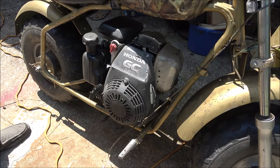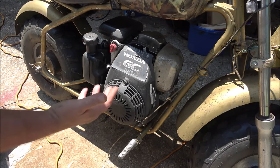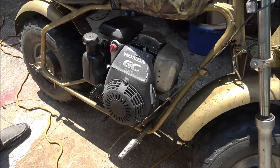I did find a problem with it — the solenoid was bad and the CDI box was bad, so I'm going to order those parts for him. He was telling me it was smoking, but he didn't tell me it had stopped running — he just kept cranking and cranking until the battery went dead. He brought out a paper bag full of parts that he got when he got the cart from his neighbor — a used ignition switch, solenoid, CDI box, and spark plug. That told me somebody had been troubleshooting this before.